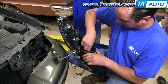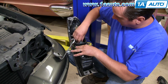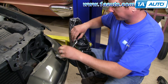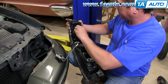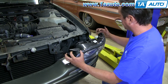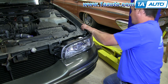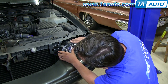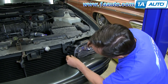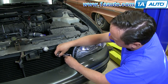Reattach the harness. Put the headlight back in — I'm going to match up these three tabs and go over with the corner metal. Make sure my gasket is put in. Reinstall the two 10mm bolts. Once you've got it all bolted back in, go ahead and turn them on, make sure they're all working and operating correctly.